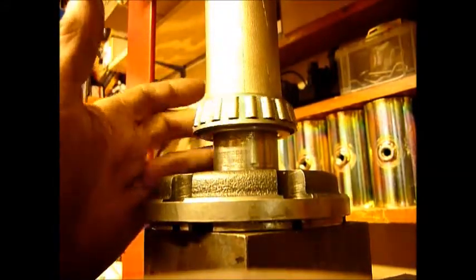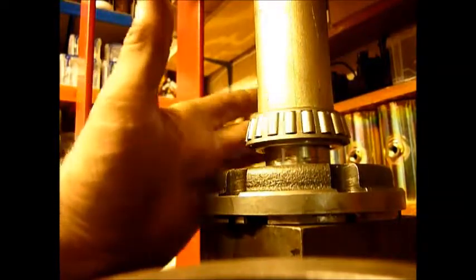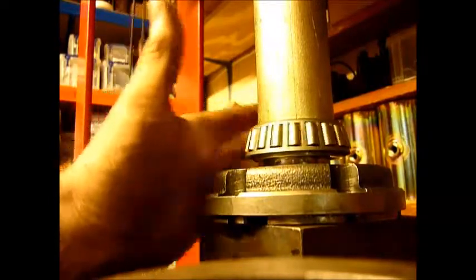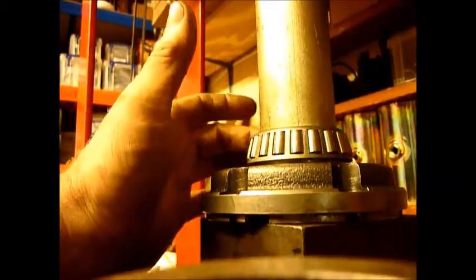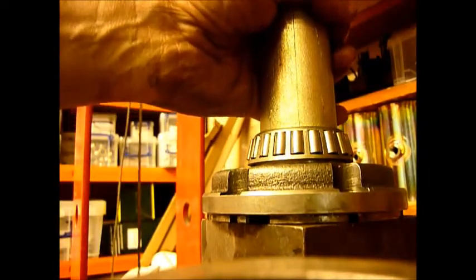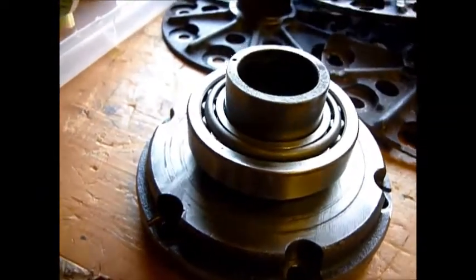Now on this one, this is a 10 spline ARB so this has a different bearing on the other side. Just settling in there, rotating the bearing to make sure it doesn't catch on the race as it goes in. This is an STC 2726, which has a different internal diameter and is only used on the 10 spline ARBs. We've got a bundle of special tools to make sure we don't wreck stuff because these bearings are really quite expensive.